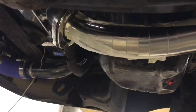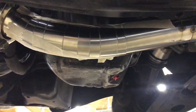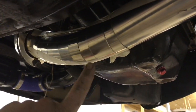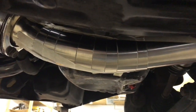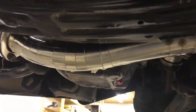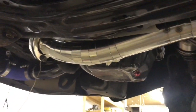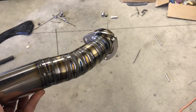Doing a quick video on this exhaust. As you can see, there are a bunch of pie cuts we're using to shape the exhaust the way we want. This is an absolute pain to do, so a quick tip: use masking tape to hold everything in place so you can position it the way you want, then run a couple tack welds and it will be a lot more solid — and you'll save yourself a lot of frustration. Going to get this tacked up before it falls and show you guys the rest of it.